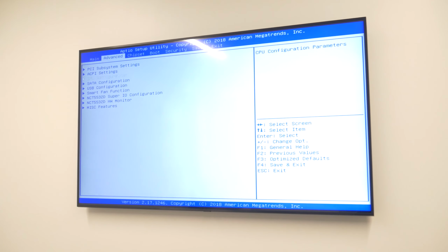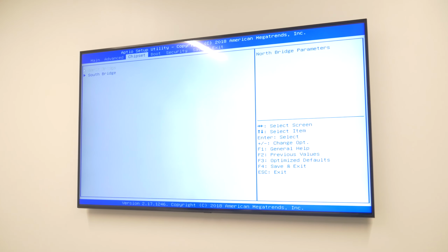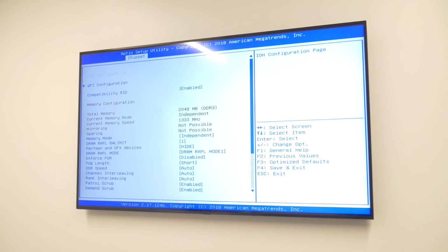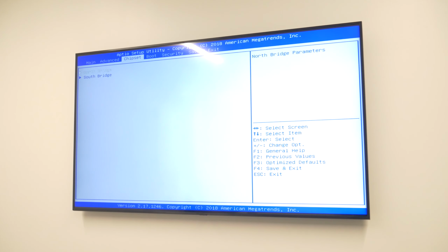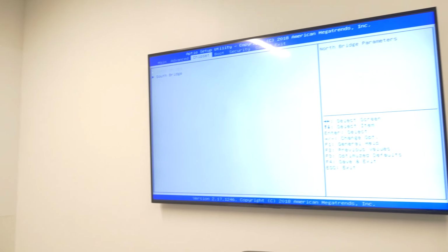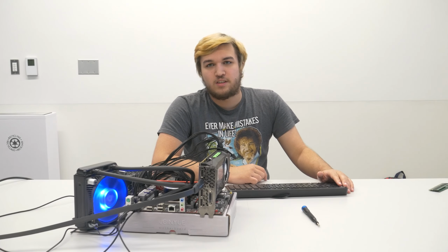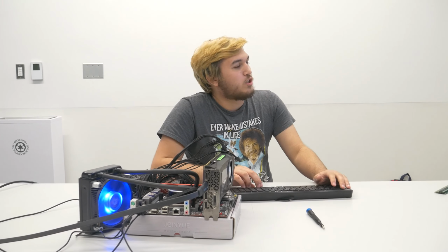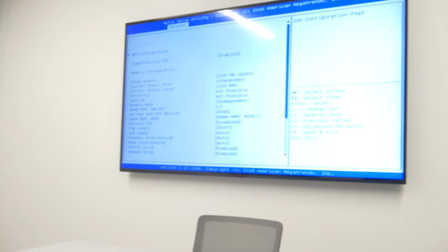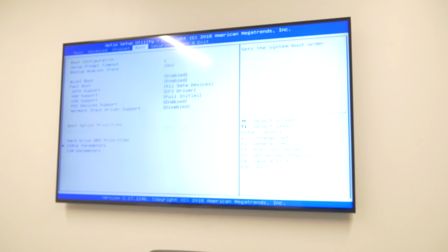Alright guys, let's go through this BIOS for a second. I'm a little excited. Normally, there would be something for our M.2. It'd be nothing there. Southbridge. That's Northbridge, yeah. So you can tell this board's BIOS is extremely old because it has Northbridge. Motherboards didn't have one years after this, but I can see what they mean. This is usually where the memory controller and stuff used to be, so I guess that makes sense. So let's see if our drive is recognized.